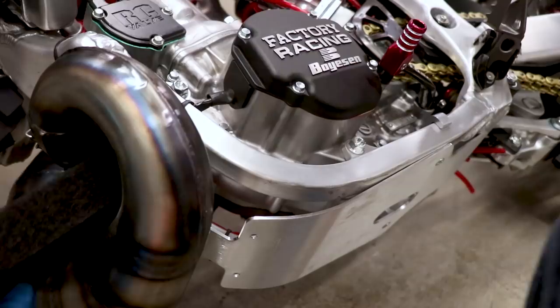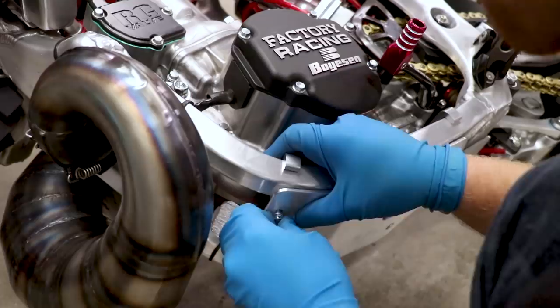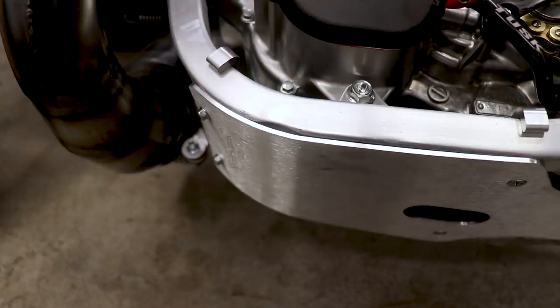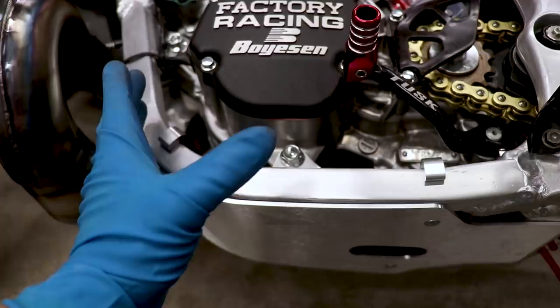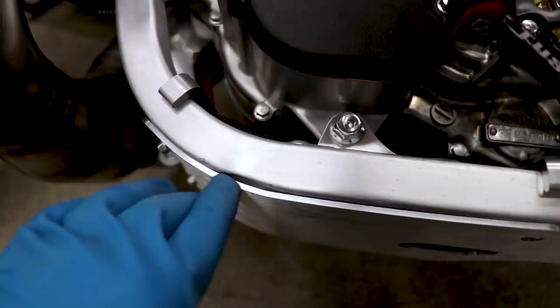Before getting those front brackets in, I'm going to stuff the foam inside — the foam helps prevent mud from packing up in the skid plate. Now we just gotta tighten this baby down. In my opinion, this is one of the better skid plates — or glide plates as some would call it — that you can buy for a moto application. It's made of nice thick aluminum and it's not going to cause a ton of vibration issues. If you're riding woods you'd want guards that come up and protect the engine better, but for moto, this is the ticket.